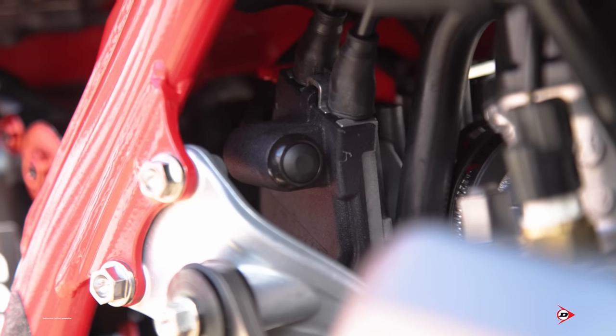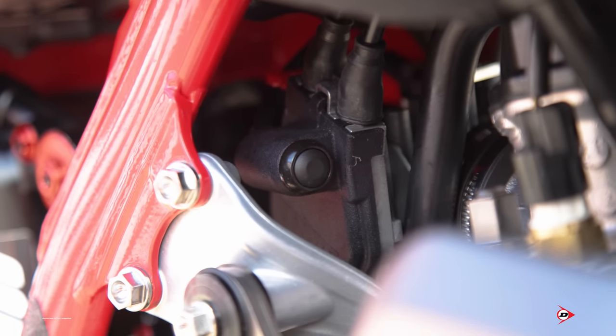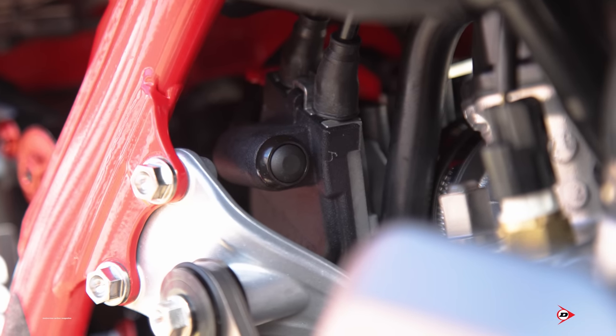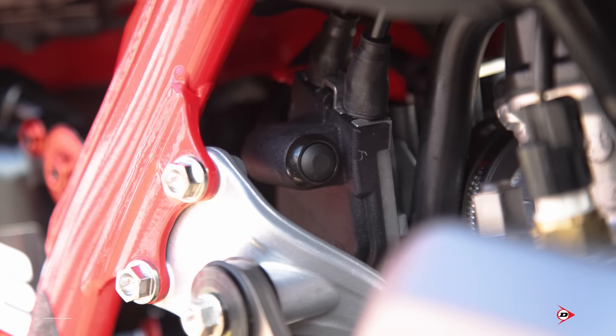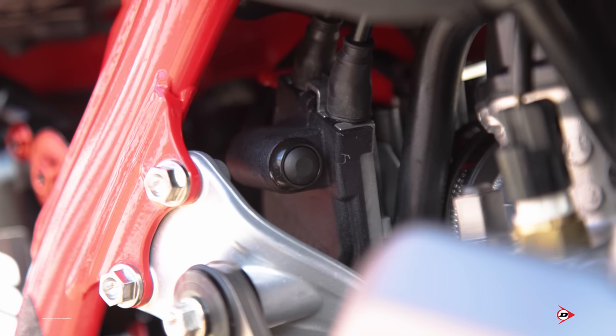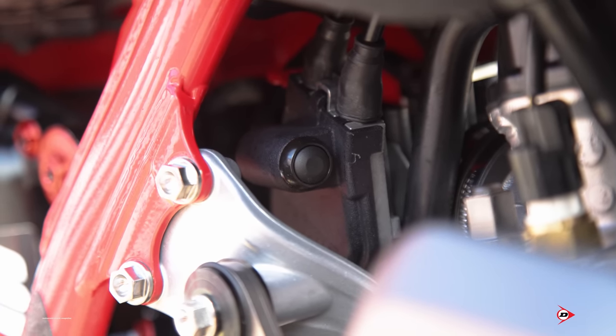Justin likes as much grip as he can get anywhere he can on the bike. That's actually just the engagement button for our start light that is on the front fender that I touched base on earlier. That just turns it on. And we also have two different actual start maps. You can just click it once and it'll give us, I believe right now, kind of a mellow start map. And if he holds it for 2+ seconds, it'll start flashing, and then that's when it engages it to a more aggressive start map. So a little bit more power off the gate on the throttle body.